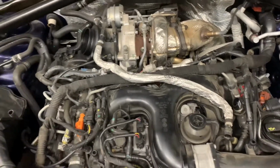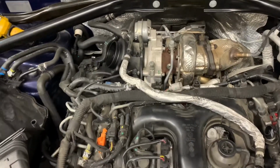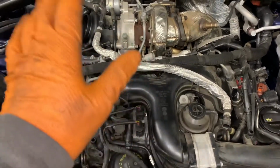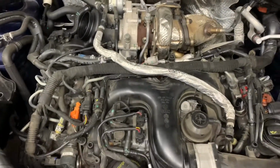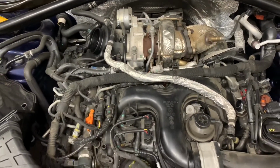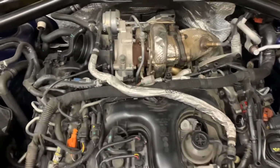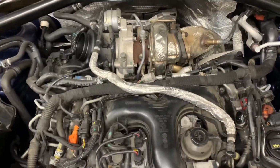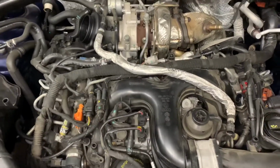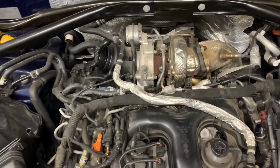Okay, so we've got an Audi Q5 3 litre V6 TDI. It's the later engine. It lost power on the motorway, with smoke pouring out of the exhaust, etc. It's come in for investigation: low rail pressure codes are set in the ECU. Cranking over the engine, we've got 30, 35 bar of pressure coming out of the high pressure fuel pump. So it's likely that the fuel pressure has dropped because the pump has broken itself up at speed.